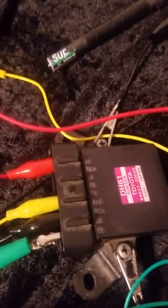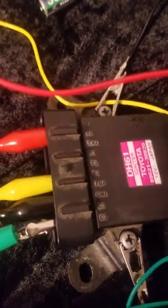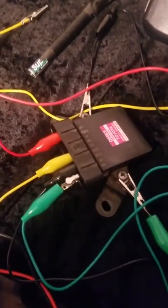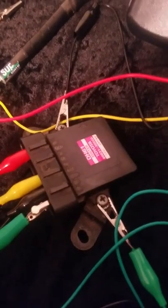Now I've got T3 hooked up for the trigger and C3 connected to the meter leads. I'm going to pulse that one with the 5 volts — it looks like everything checks out. I almost hoped this thing was bad because that would have solved my problem, but now I've got more issues to check. Anyway, that's my way to test the DH-61 igniter — I hope this helps anybody out there.